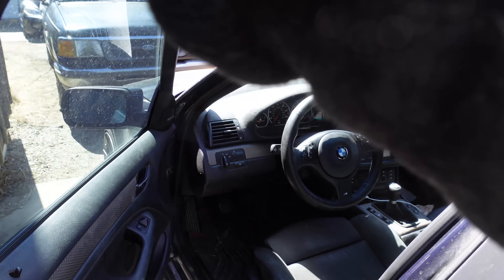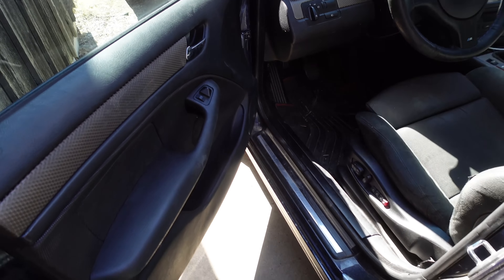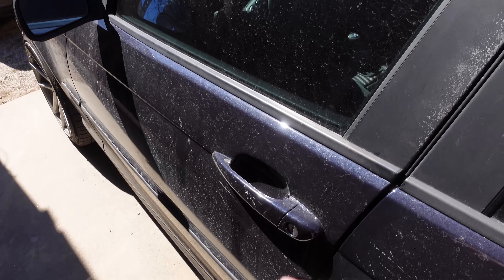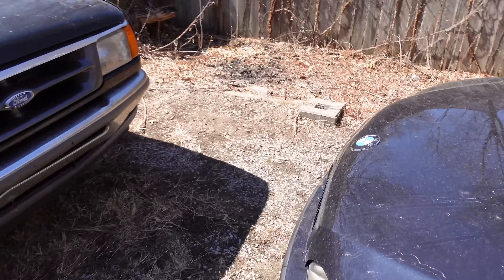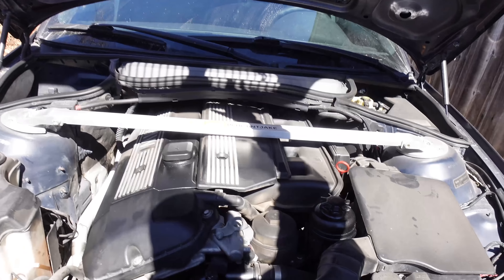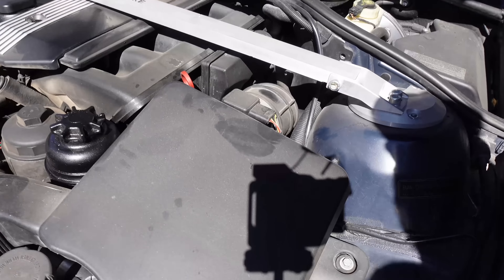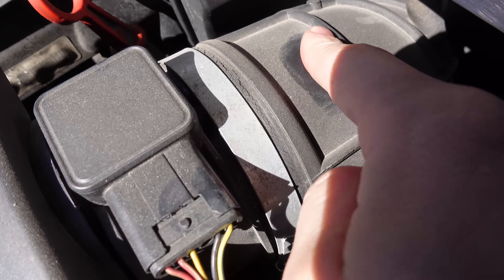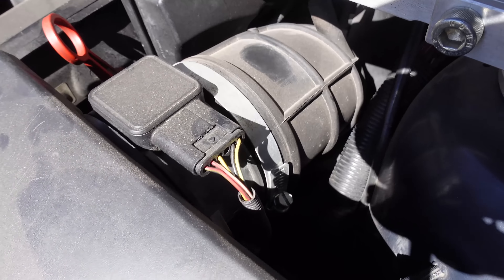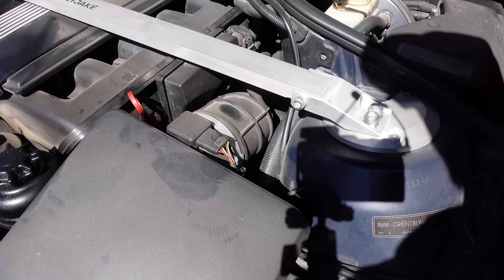The problem I've been having has been wonky cold starts, mediocre fuel economy, poor idle, and lean codes. Most of you already know what this is going to be, and honestly, I should have done this a long time ago. So under here we have an M54B30 engine. You've seen this all before. And here is a very common issue with them: the rubber intake boots crack and create a vacuum leak. This isn't even a BMW issue — this is just all cars. All recent cars have vacuum leaks. It just happens.